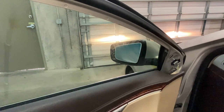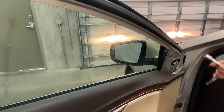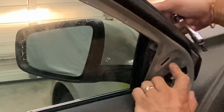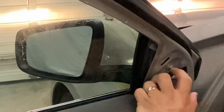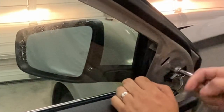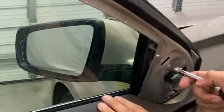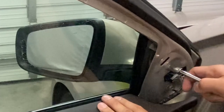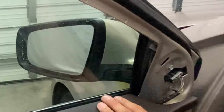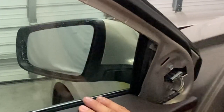Turn off the car and let's put it all back into place. Don't use an impact gun — I know you'll have the tendency to make it go faster, but you're really just creating more problems. These things are held on by a plastic base, and if you tighten it too much it can actually break the stud and the mirror is going to be useless. So just hand-tighten it with this wrench right here. When you feel it grip, tighten it just a little bit — that's all you need. There we go, that's good to go.